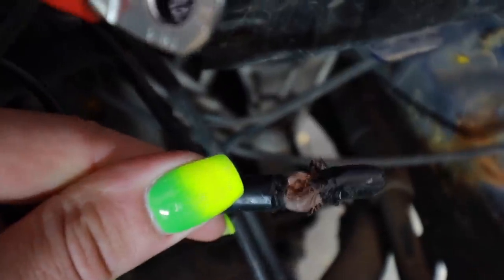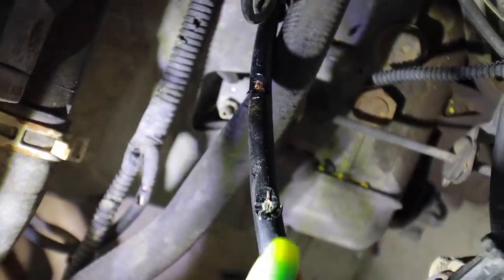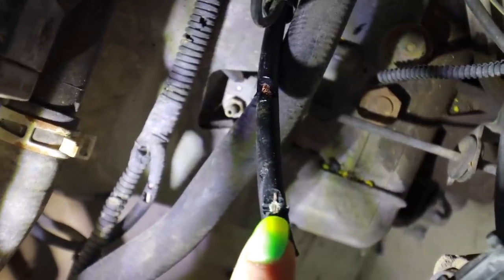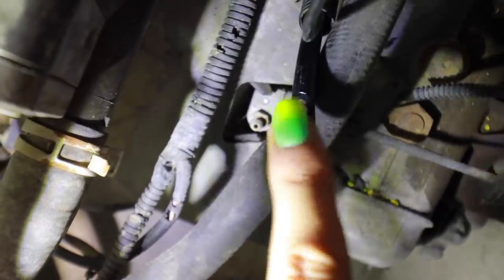This wire right here has a case of the creepy green death. That stuff right there is the reason why the previous two owners of the MR2 could never get it to run — it had creepy green death on like eight different wires for the fuel system. Like any good archaeologist, I just did a couple core samples on this wire that goes to my starter. And as you can see, creepy green death. You go back an inch or two — nice fresh copper. It looks fresh just an inch or two back and that will still work for me.